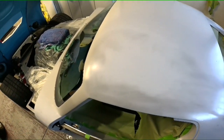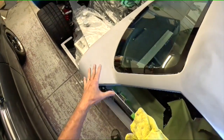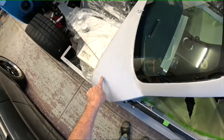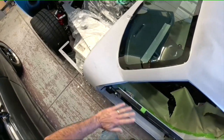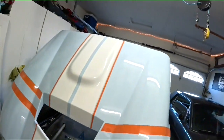Up into the rounded surface I'm using a foam pad and working at different angles; down here I use the small block. This area is pretty well blocked out, needs a little 320, and then I'll flash these areas with a touch-up gun and block those out — then it's ready for paint. Hopefully next time you see this thing, I'll show it all masked off for one more episode on final paint. The hood's already been cut and buffed. Hit subscribe and we'll keep them coming.